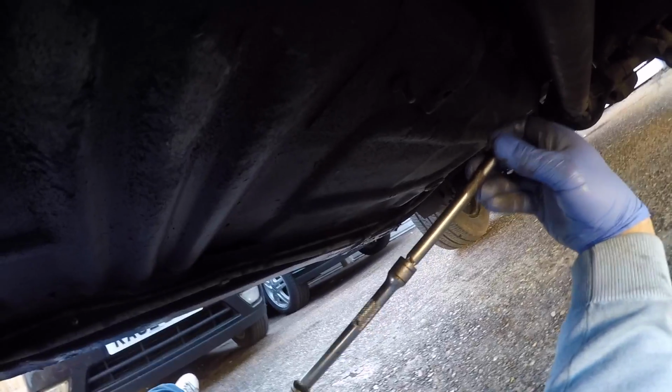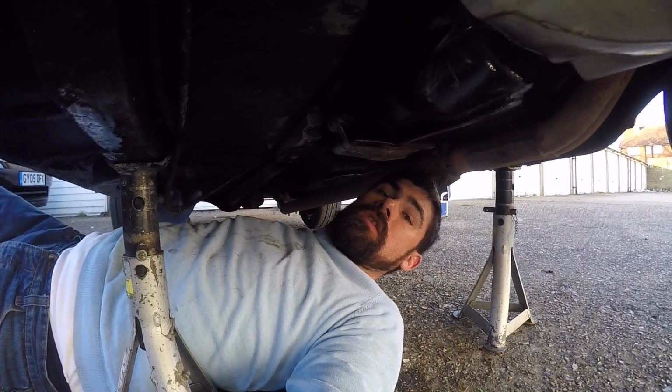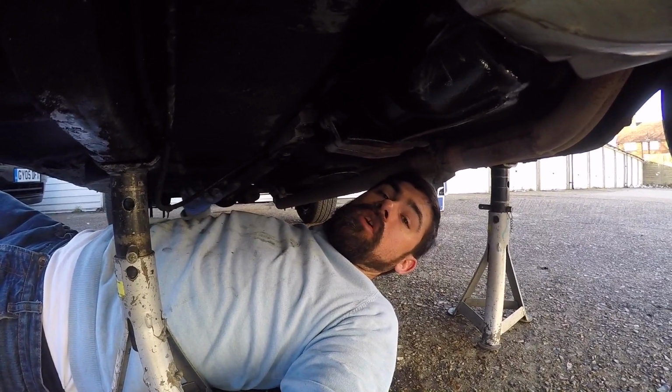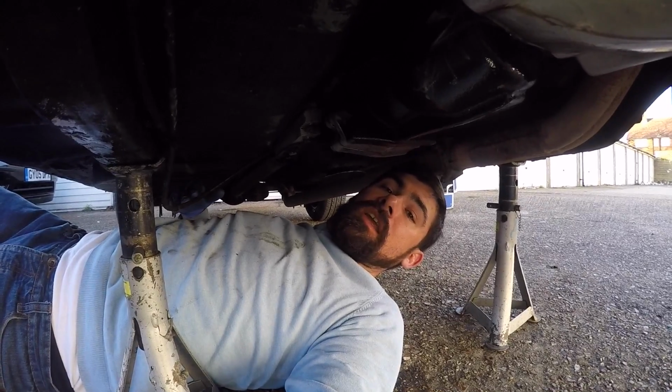Now one option is to drill a hole in the gearbox tunnel, both sides, roughly where those Allen key bolts are, and I'm considering doing that. But one thing I'm going to try first is by getting myself a flexible one of these bars. I've seen them on eBay and I'm going to order some later on. Now I'm determined to change the gearbox next time without going through the hassle that I did this time. So I'll let you know how I get on with either using the flexible shaft or if I have to resort to drilling a couple of holes in the gearbox tunnel.